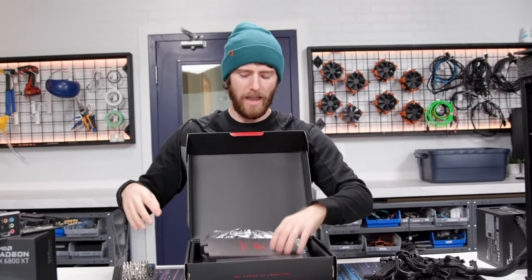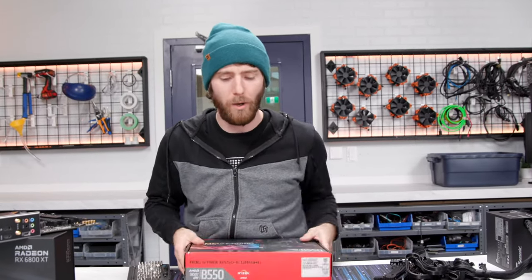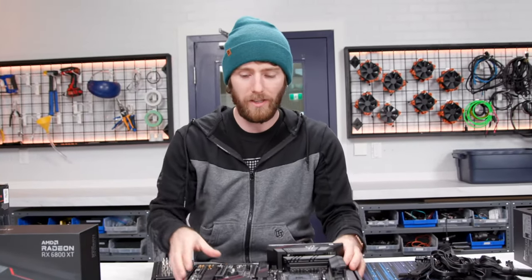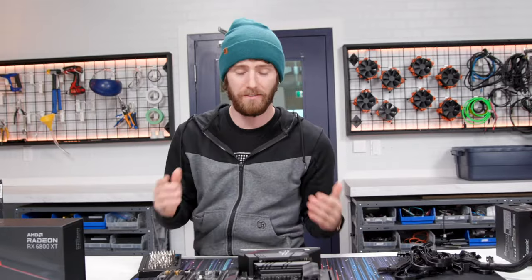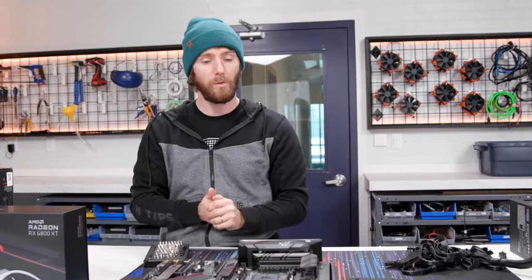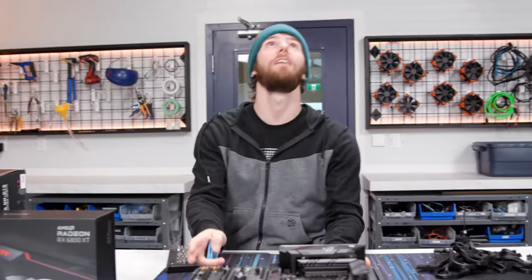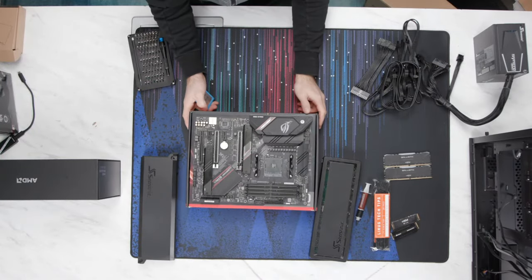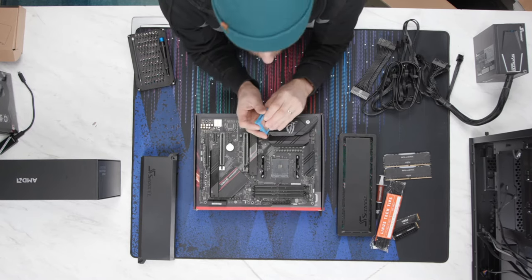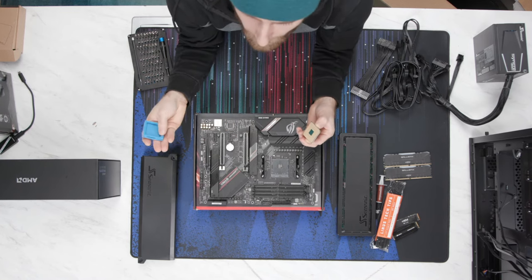Like, I had an issue a little while ago where a firmware update was causing packet loss in my home network on my switch. And the only way that I was able to troubleshoot it, because I didn't have another network switch handy, was by just connecting to Wi-Fi. And I was like, okay, if Wi-Fi has no packet loss and wired does, then we got a problem on this network here. So it's handy to have as a kind of troubleshooting tool, but I also understand why people don't want to blow money on it.